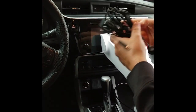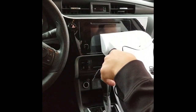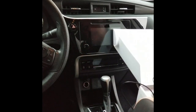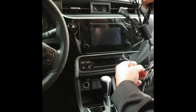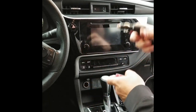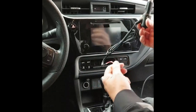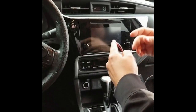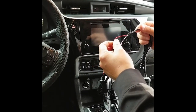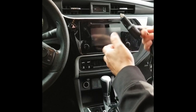This is the CD player adapter. There are a lot of cables here — it looks cumbersome, but this is merely for demonstration purposes. You can tuck all these cables away so you're only left with a few loose connections. We've already spoken about the mini jack headphone connector for audio. There's also the cigarette lighter power adapter. If you want a quick installation, leave it connected. Alternatively, you can cut the connections and hardwire the CD player to a keyed accessory — power when the key is on, then off — along with a ground wire for stabilization to prevent shorts or static issues.